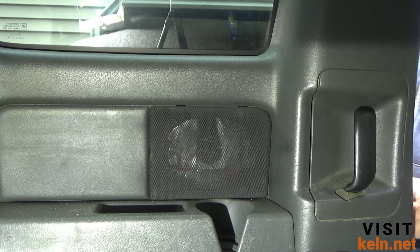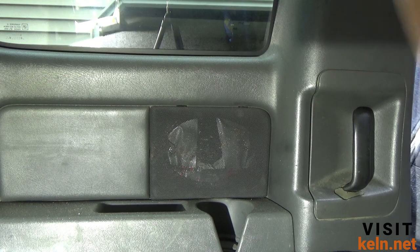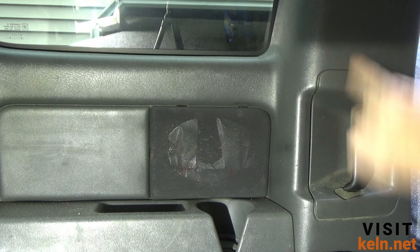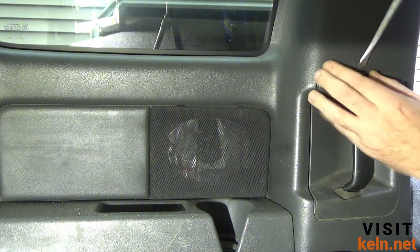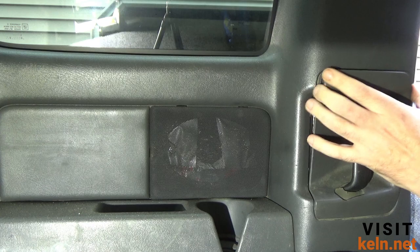What's going on is when I pull on the door, the upper latch disengages but the lower one does not, because the rod that connects from the handle down to the lower latch has disconnected. So all we have to do — it's really not that difficult. Pop this out — a screwdriver's probably not the best; you might want to use a trim tool if you have one.